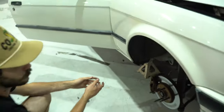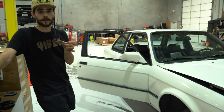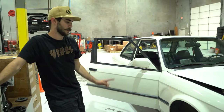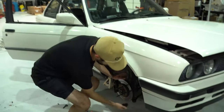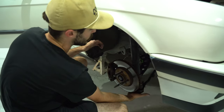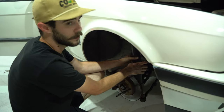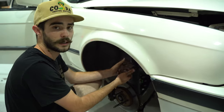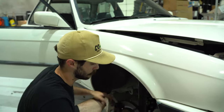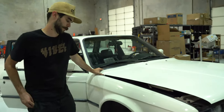The way they have the adjustment set up is kind of cool, especially for the rear because the dampening adjustment's at the bottom, instead of the top, so he doesn't have to go through the trunk. So it makes that easier. The front though is interesting because the bottom of the spindle is closed, but the adjuster for the front coilovers is on the bottom, inside there. So you actually have to drop the suspension and unthread the coilover from itself to adjust the dampening. So we might come up with a fix for it. We might drill a hole on the bottom and use some BC or Airlift strut extenders for the dampening. But I guess we'll find out. Right now it's not a big deal.